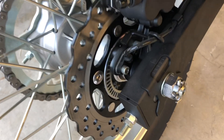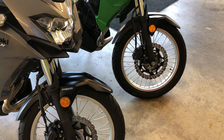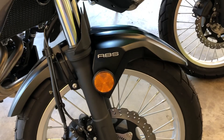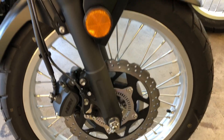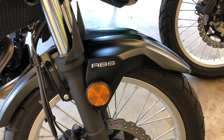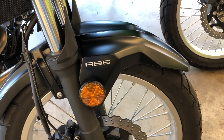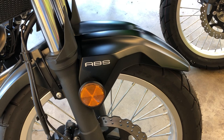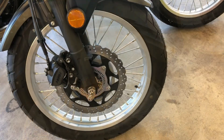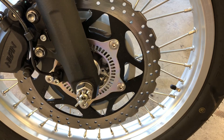You'll also notice the bike has ABS brakes on the rear wheel. Now, there are a few more subtle ways to tell, but you really don't need to pay attention to those. You'll notice the ABS label here on this bike — it does have ABS. But let's say that fender might have been cracked, replaced, repainted, or someone just didn't like labels and took them all off. How would you tell then? There are some differences in the brake system just slightly, but there's really no point in knowing all of that. All you really have to do is look for either the presence or absence of the ABS sensor wheel.